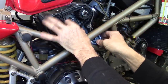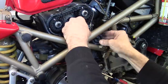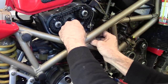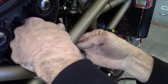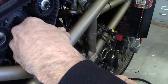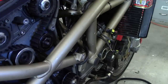I'm going to get the tensioner up here and slide it in. I want the hole to be pointing that way and the offset part to be pointing down that way. Get it up in here and then catch the belt. I'm going to get it up around the stud a little bit, get the belt in place, get it as close as I can to getting on that stud. If I take a screwdriver and just gently pry against the case a little and give it a push — there it goes, it's on the stud.